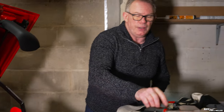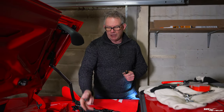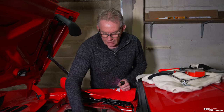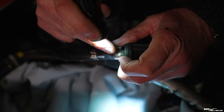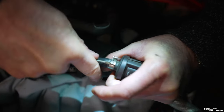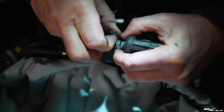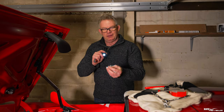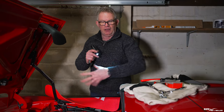You're supposed to use the cutting section on the ear bracket pliers to cut the clamp off, but that means bits of metal flying everywhere. A better, more refined way is to tease off the retaining clip from the bracket and then unravel it — you can't reuse these brackets anyway, so you just need to make sure you don't damage other parts. The bracket clips onto a nodule, so I'm just going to lift it off that nodule and then unwrap it.